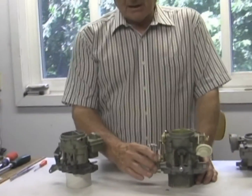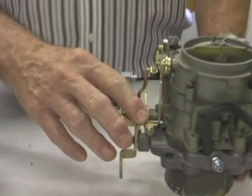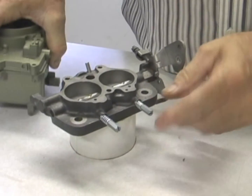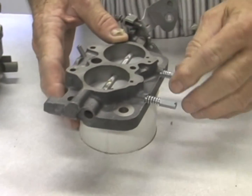I get a lot of questions about idle circuits. In fact, getting a tri-powered idle correctly can be one of the most difficult challenges. Obviously there's a few factors here. There's your idle adjustment screw on the center carburetor, which everyone's familiar with, and then beyond that there are the two idle air mixture screws that I get a lot of questions about.